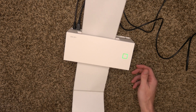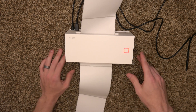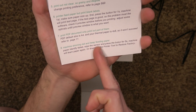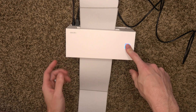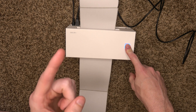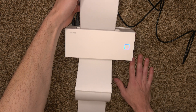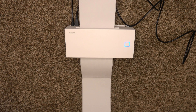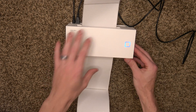This thing needs to be calibrated. I press it once and it just doesn't know what it's doing. I actually had to consult my user manual for that one — machine flashing red and keep feeding paper, paper identity failed, wipe sensor, press button for five seconds. So I had to wait till the second beep — and that's a calibration. Wasn't too difficult to figure out, but if you didn't know, you wouldn't know. Now it should feed — one label, perfectly fine.